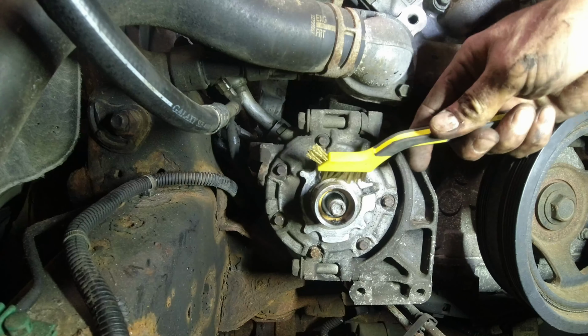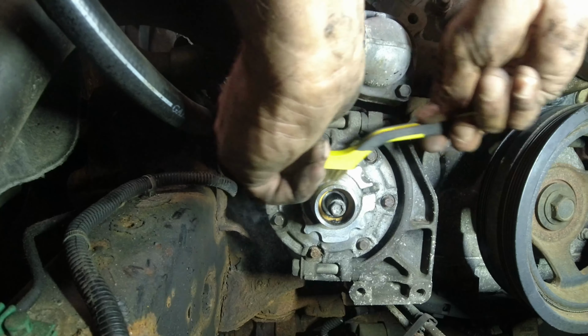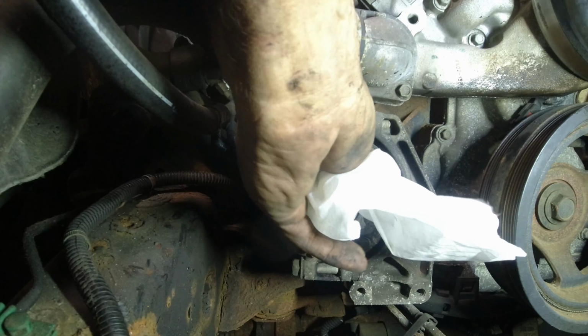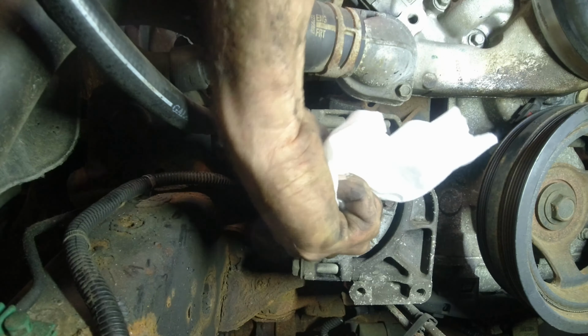We're off. Use a little brush just to get a little crud out of there. Alright, and we'll use a little bit of brake clean. Spray it off a little bit. Wipe it down. Oh, no crud on there. The whole surface, everything. And then there's a little groove in there where we took the C-clip out. A little pick, and just go around it. Clean it off again.